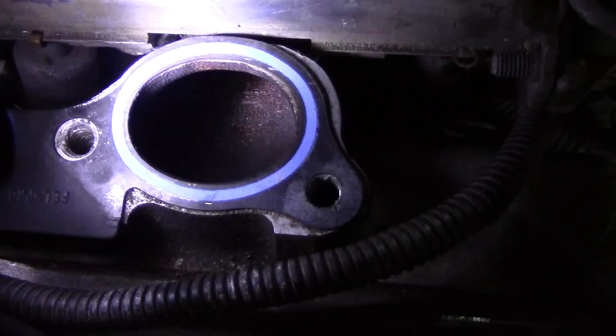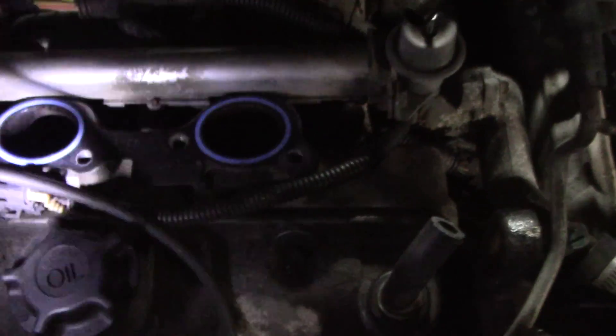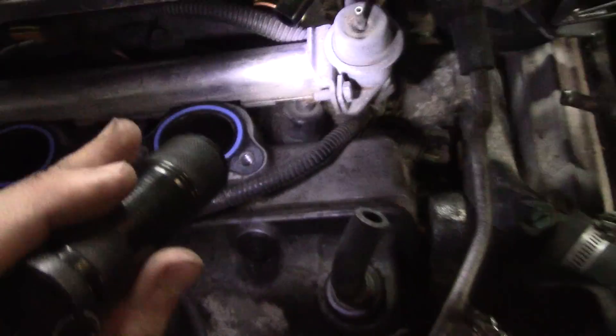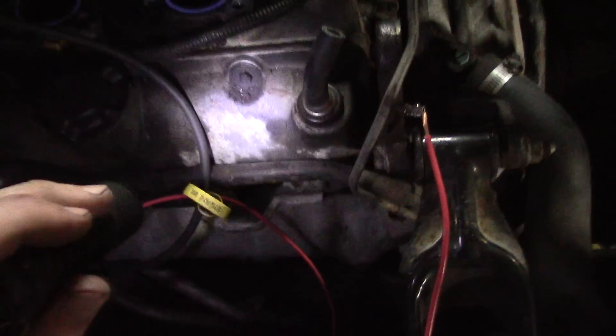I'm in here now with the door closed, it's very quiet. I'm going to hold the camera up real close when I tap this and see if you can hear the injector spray fluid into the cylinder. It will actually echo up out of the cylinder tube. I tested this for all the injectors and got them all to kick on and make this noise. So here's the one up front — the one that was giving us problems. This front cylinder is the one we were getting a bad read on. Let me jumper that injector.